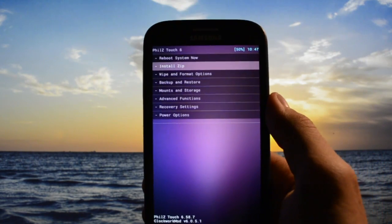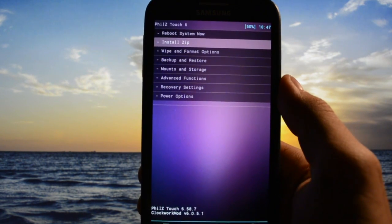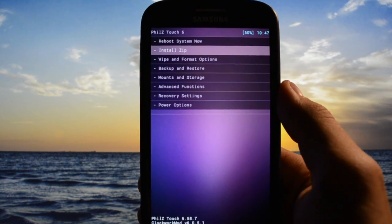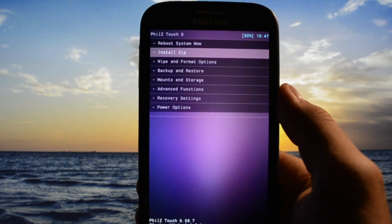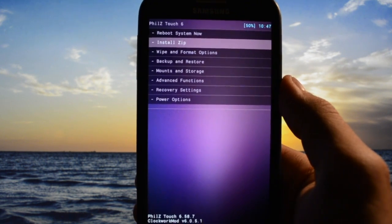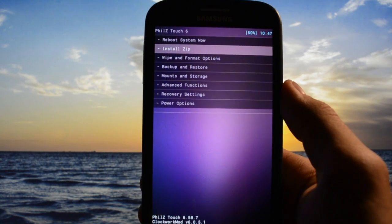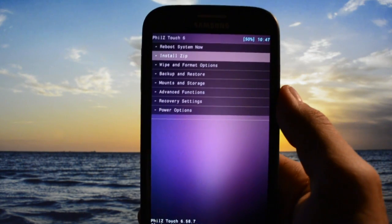This new variant comes with a new base — OF2 base, the latest Lollipop base from Samsung. It is recommended to make a full wipe before proceeding to the next step. If you're running a previous version of Omega, let's say version 41, it's very risky to flash this without a wipe. You may try it, but if you run into some problems, make sure you wipe and flash it again.